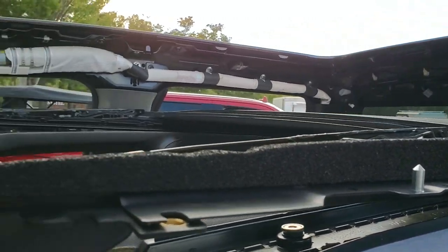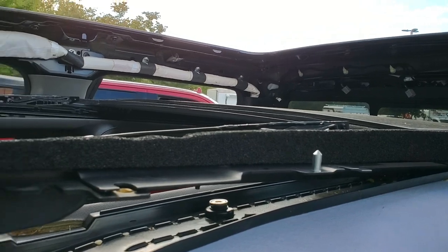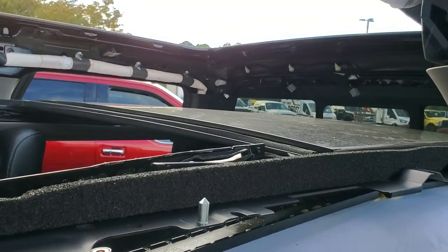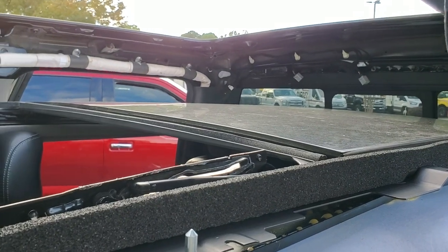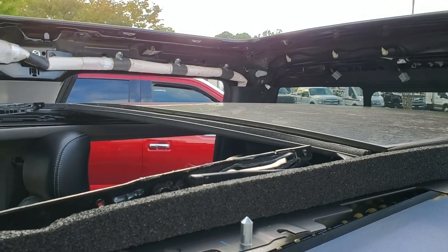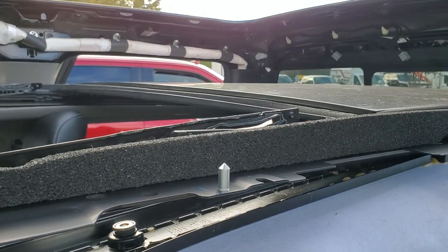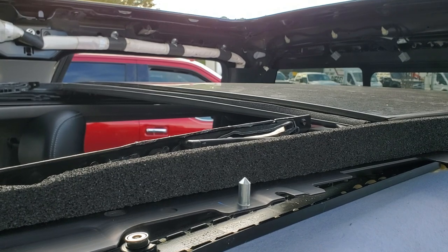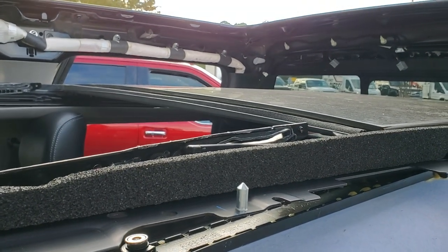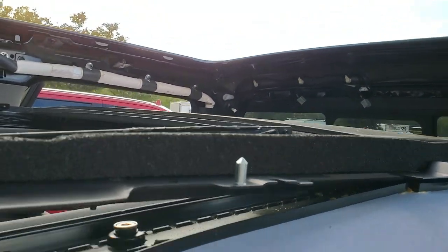Re-installation is going to be brief. We're having battery issues on the phone. This track is now sitting in here — I put it right back in just like it came out. It's sitting on top of the headliner and I have set the rear glass in, because that must be in there before you can bolt it up. I've also crawled under it and installed all six screws so it won't slide around — not tightly, they're just started. I don't want it to slide to the back and catch under the lift of the roof when I push the track up.